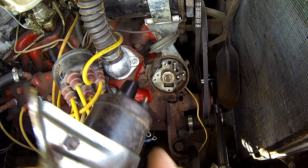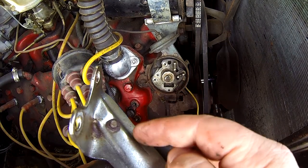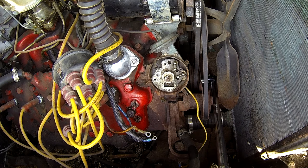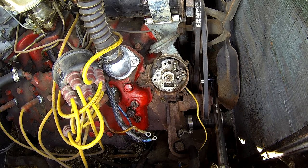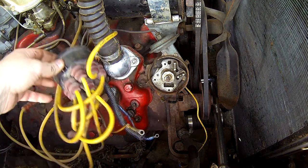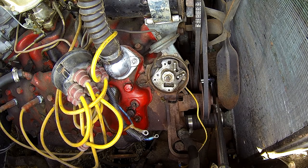That's why I didn't just try to swap the coil directly from the bracket — there's a flathead nut on the back that's guaranteed to get lost if you try to work with the coil in place. Taking the whole bracket off using those two bolts is much easier. That basically takes care of freeing up everything we know is getting replaced, except for the cap. I've left the cap on to tell me where the wires went, because they've got to go back in the right order — so that'll be the last thing I disassemble.